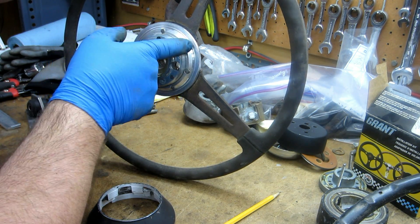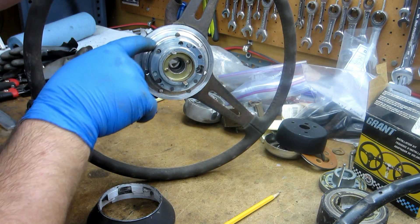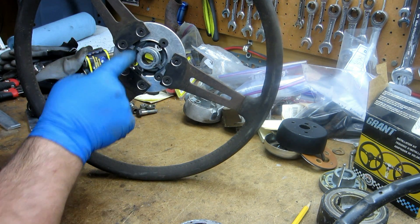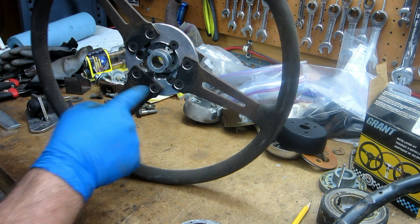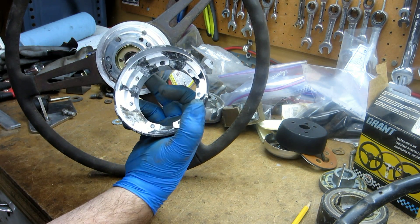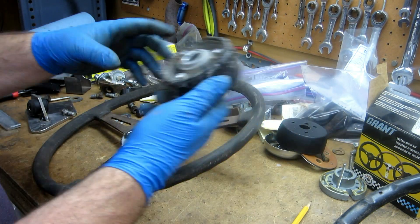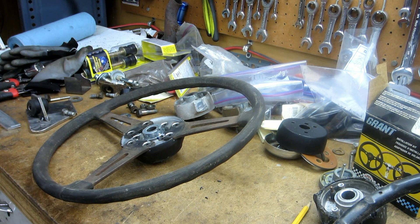You can see the 320 hub in the center, and I machined an aluminum ring around the outside. It looks like it was for something else because I didn't put the knurling in here, and apparently it was another piece of aluminum for something else. What I did was modify it: cut away the 320 hub, drilled a bunch of holes, countersunk it on the back side, then drilled and tapped for the steering wheel bolts. That's kind of why I'm saving the hubs - at some point I'll figure out a way to make an adapter for guys who want to put custom steering wheels on, but you can't find the adapters anymore. It's on the project list but way down.